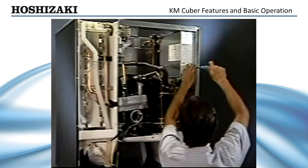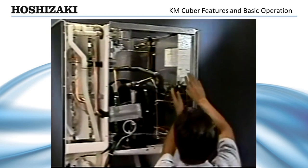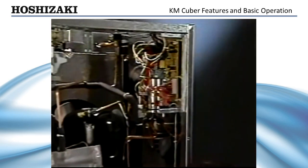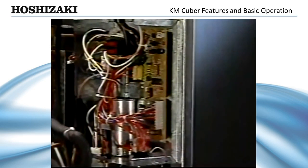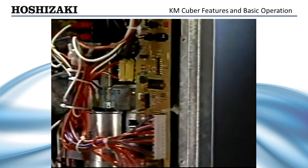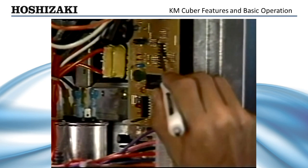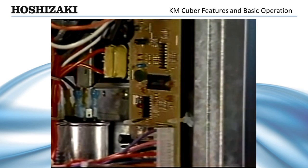For improved cleaning, the pump-out timer on the circuit board may be adjusted to lengthen the cycle to 20 seconds. It can also be adjusted to occur every one, two, five, or ten cycles. These adjustments provide the service technician with the flexibility to overcome some problems associated with the high mineral content present in some local water supplies.